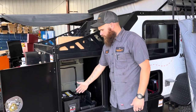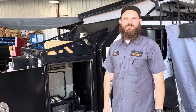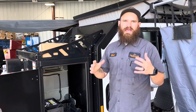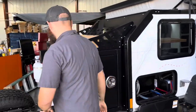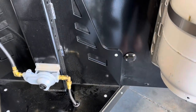This is our battery compartment. We currently have a group 24 lead-acid battery in here, but there are many different combinations we could do to accommodate your dry camping needs — we could upgrade to 6-volt batteries, lithiums, add solar packages, whatever you need to make sure you're not running out of juice while camping. This unit is also pre-wired for portable solar right behind the propane tank.